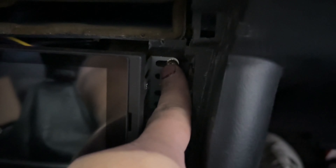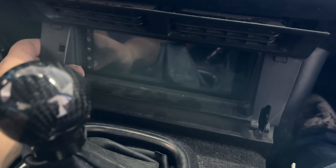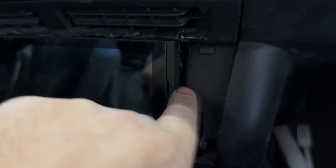All right, we have it fully mounted now. The brackets it came with are a little bit too tall, so what you have to do is cut out the plastic piece that goes on top here, and then I cut a slit into this plastic to bend it upwards just to be able to get that guy in. But other than that, it's fully mounted. Let's see if we can get the plastic trim back on — the hope is we can make it look as factory as possible. It's not going to fit with the factory trim, so we're going to have to trim out these tabs here down along this way as well as up here, just to give it the little bit of clearance it needs to be able to fit.